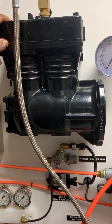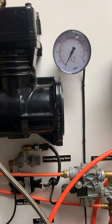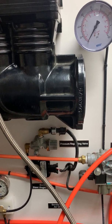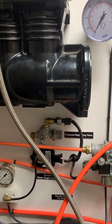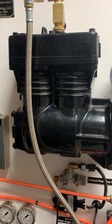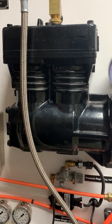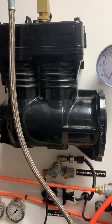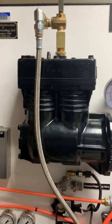This makes the air compressor — even though it's still being driven by the engine — incapable of continuing to build air, because all the air pulled in by the piston's downward movement is pushed back out. What you're really doing is eliminating the condition of a vacuum existing by keeping the intake valves open, making it incapable for the compressor to create a vacuum, thus ending the work cycle.